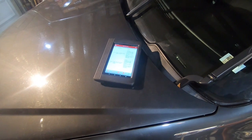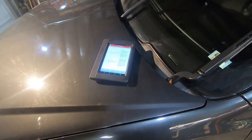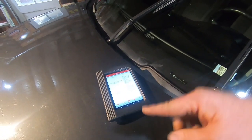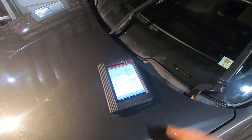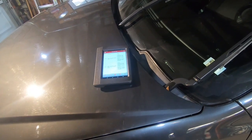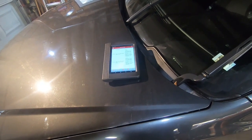I'm going to take the right front wheel off, take it apart, and see if I can see anything wrong with the wires. If I don't see anything wrong, I'll probably just replace the bearing, because that's usually what it is. I took it for a drive in graphing mode with live data — it was working really well, and then just out of the blue it spiked up real fast for a split second and the light came on. I could see on the graph the right front ABS sensor spiked real high for a split second. I think there's about a five mile per hour difference between the wheels before it throws that code.